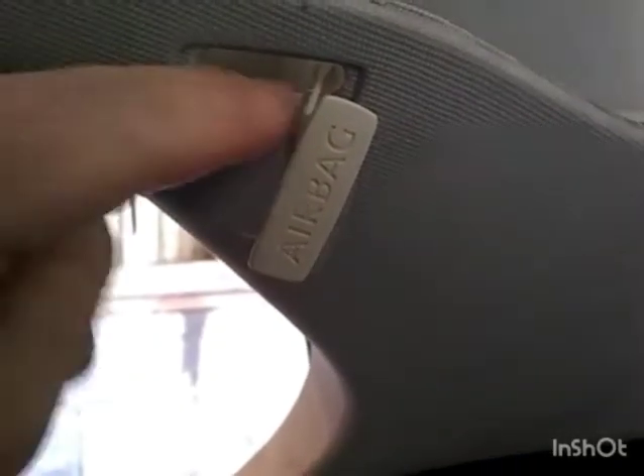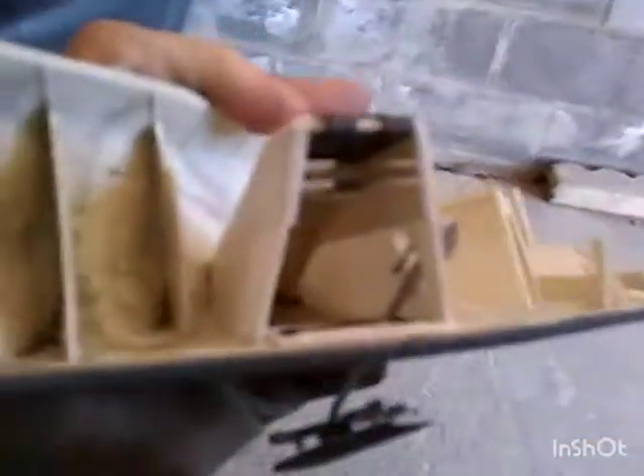It's going to be exactly the same as the other ones — there's a little airbag sign on the C-column. Up in there there'll be a screw, and once you undo that you're going to have to pull it pretty hard. It's going to snap out of these two here and back there. Once you do, raise it up and away and it will come out. And I think that's where my leak's going to be — I can already see water in there. So I think that's going to be my problem. It's just been running down and around here, leaking back behind the chair. Usually if you pull this back while it's raining and look down inside, it'll be a little wet spot coming down the back. Yep, that's the culprit right there.